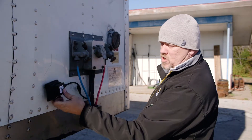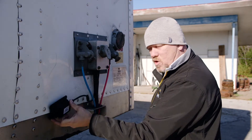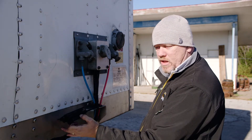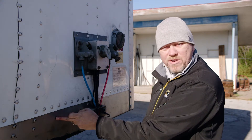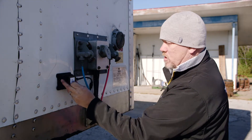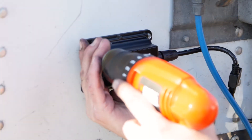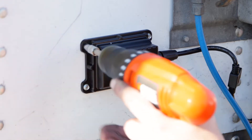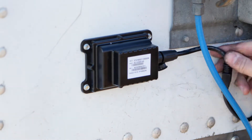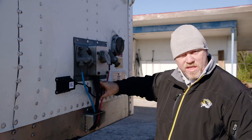What I'm going to do now is surface mount this to the outside of the trailer. Ideally, you want to connect to the most solid surface you can. On this individual trailer, this is quarter-inch steel down here and I can't drill through it, so we're going to put it right above it and surface mount it on the body itself. You'll see that it's very securely mounted. Once we do that, I'll take zip ties and make sure that this wire is secure and out of the way.